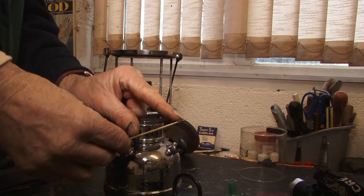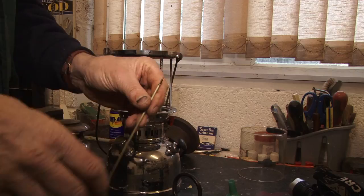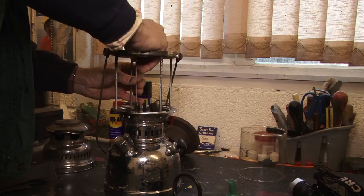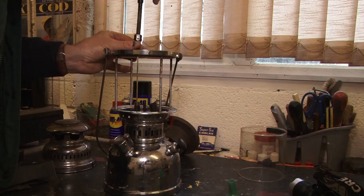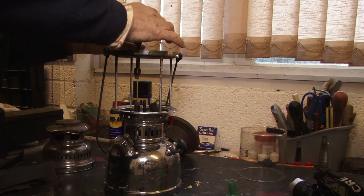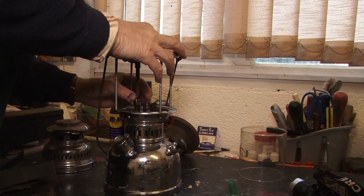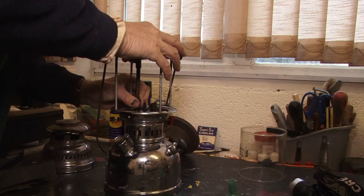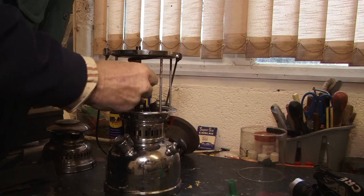Having cleaned all the brass center needle and either straightened or bought a new replacement, let's assume we put a spare in. I'm going to put it back in here, just in that central area where the fuel comes out. Just twist it down — I always check to see if it's moving up and down. Then I realign the shaft on top. This is where you've got to be careful — you've got to slide that down without bending the needle. Generally once it's inside the needle naturally comes out at the top. Make sure that you don't get cross-threaded down here.